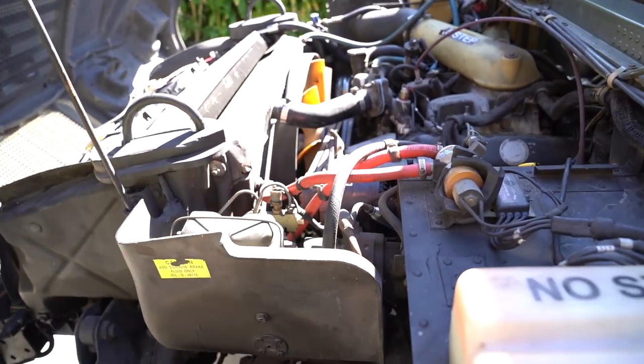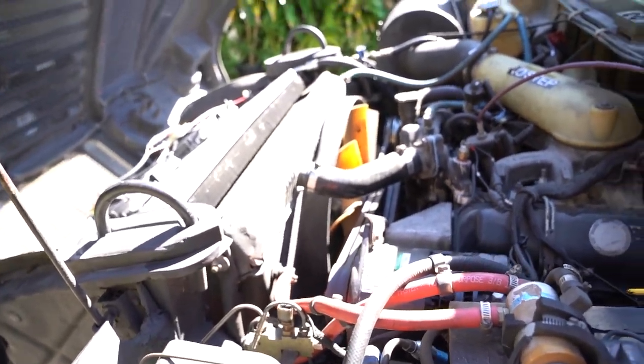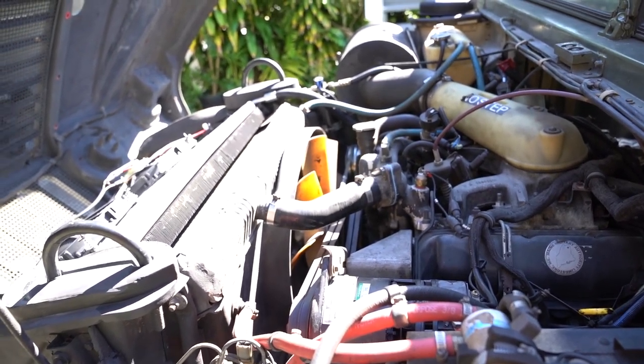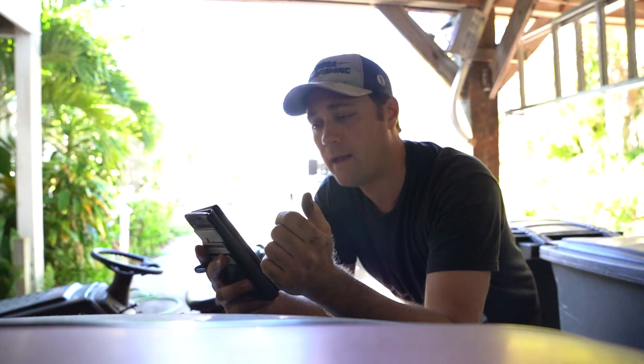With the hydraulic fan my Humvee cools so well, and with a lower thermostat — 195 fan switch and the 180 thermostat — it cools really well. As for the expense of the whole job, I think I paid like 60 bucks for my 3-inch lift blocks with the 3/8-inch holes drilled in them.